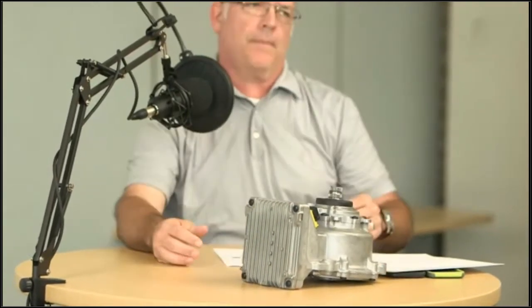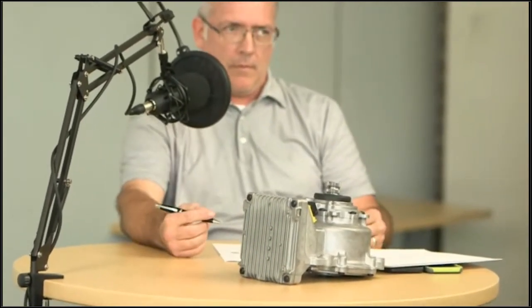So it sounds to me these marks obviously need to be inspected by a service technician, and we need to confirm that the marks are in the correct orientation before we move forward into this calibration process. So even before we're hooking ACOM or Premium Tech Tool to the truck, steering alignment needs to be correct, the alignment of the motor to the steering shaft needs to be correct, and then it sounds to me like we can take a look at the calibration of the sensors.